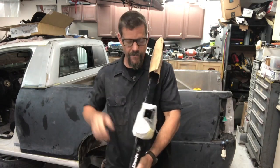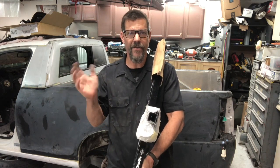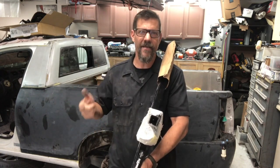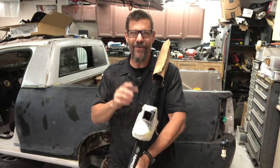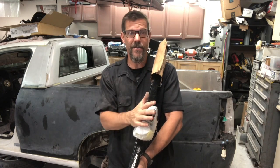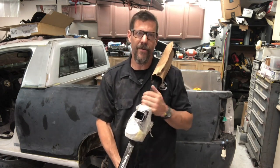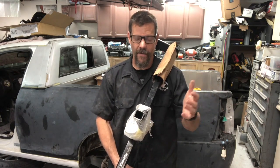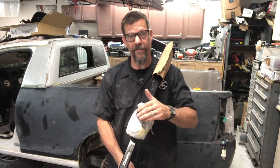I have two complaints about them. First, it's only available in one-and-a-quarter inch. Nobody makes a two-inch receiver, and I have too much invested in two-inch stuff — a motorcycle carrier, a jet ski carrier, bicycle carrier, and various assortment of hitches. You can put an adapter on it that goes one-and-a-quarter to two inch, but that adds leverage to your load which decreases your tongue weight capability.